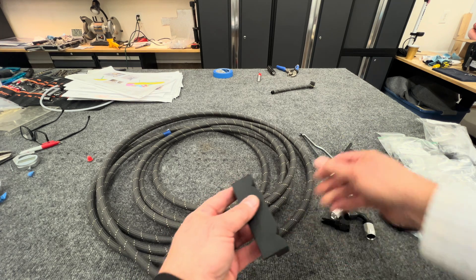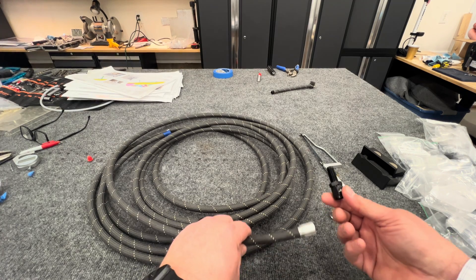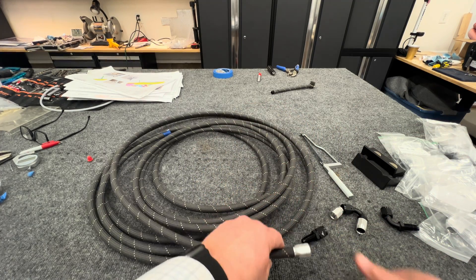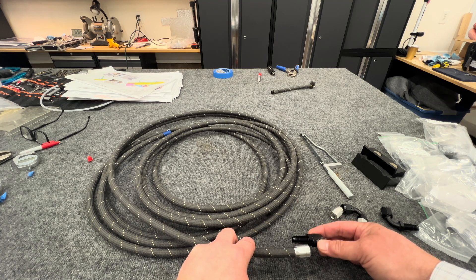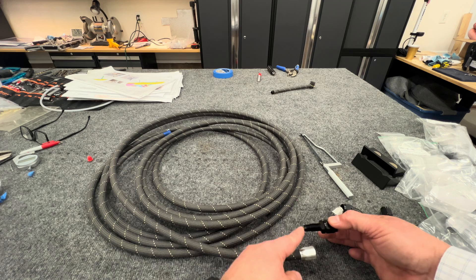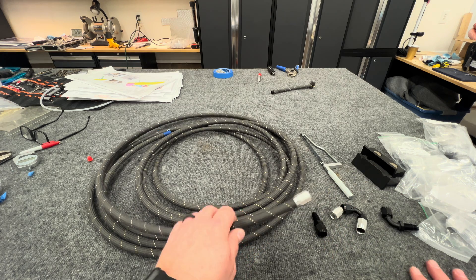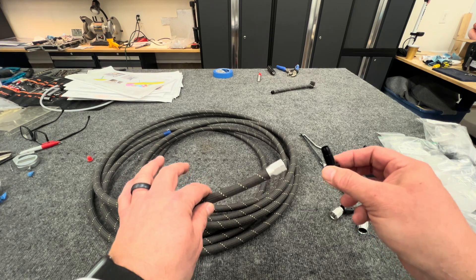There's no clamping or anything — you don't need any fancy tools. The vice clamp is not even required; I thought it was just helpful for cutting and holding it still. Once it's all the way in, you're supposed to go one and a half or two more turns to help pull the hose up tight — that's in the instructions. The manual says that once complete, if you follow the instructions, it'll withstand a thousand PSI and it's reusable. So if you made a hose and you needed to make it shorter, you can unscrew this and use it again. This is a little different than some other braided lines, so make sure you understand this is particular to this hose.